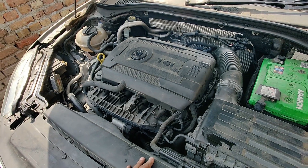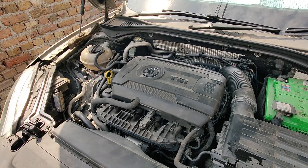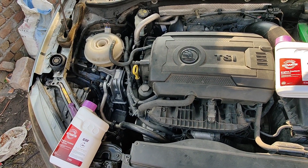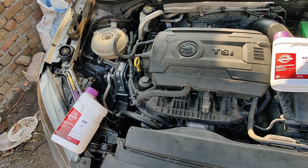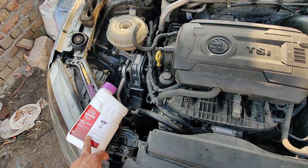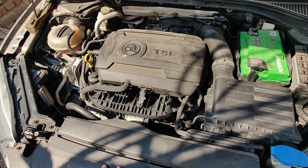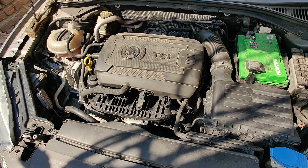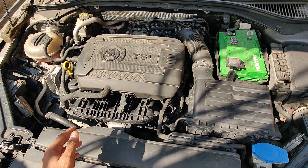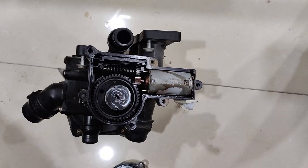Only thing left is to fill with water — using plain water first to check for leakages. If everything is good, I'll drain the water and fill with the right mix of coolant and water. After driving on water for about 13 to 14 kilometers, it's time to drain it and pour in coolant — it's a one-to-three concentrate, manage accordingly. In the next clip, I'll disassemble the old thermostat body to pinpoint the exact point of failure, because there's no point diagnosing a problem if you can't pinpoint the exact location.